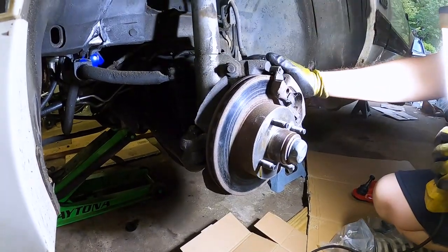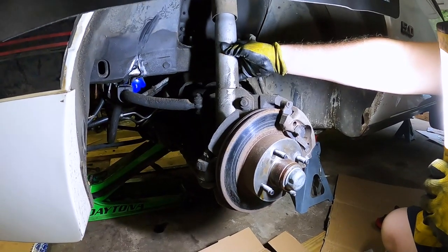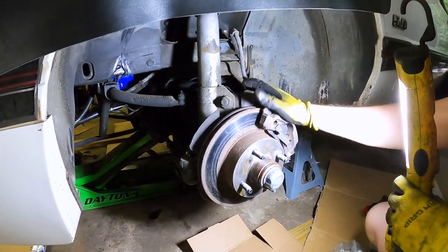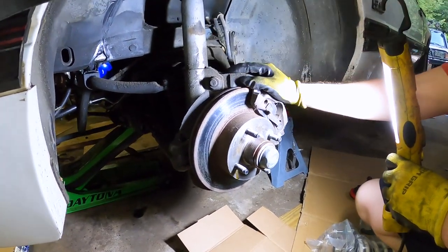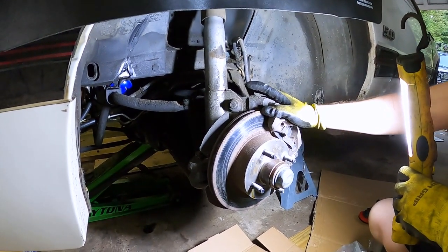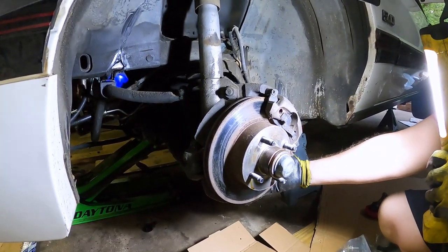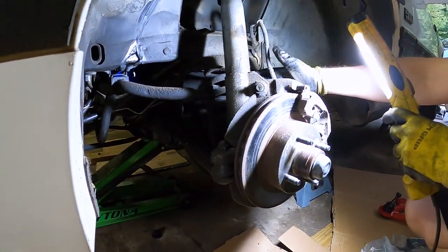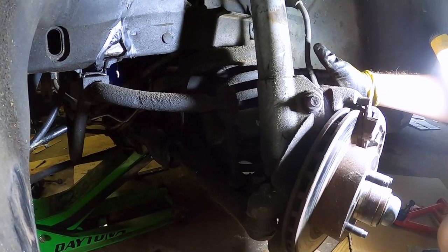On a factory Fox Body, you'll see a four-lug disc brake front setup with a strut and a divorced spring. When working around this, it's imperative that the car is safely supported on jack stands for the full front-and-rear job. You also need an extra jack placed under the lower control arm, because the divorced spring can be very dangerous to remove — take utmost care.